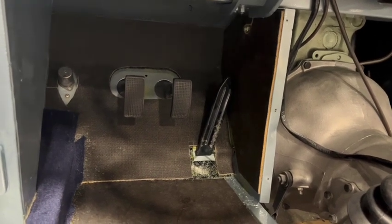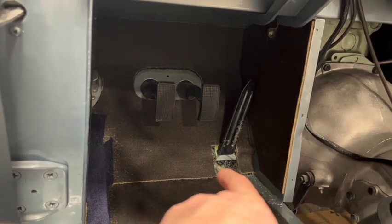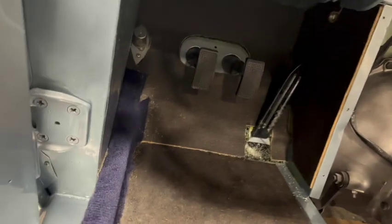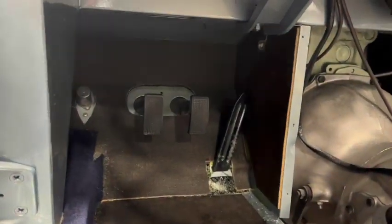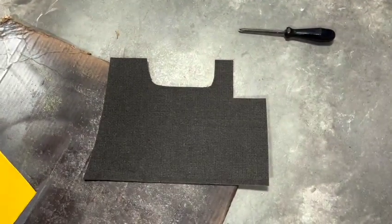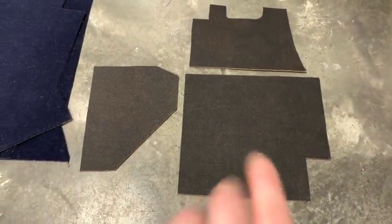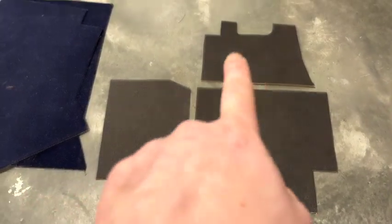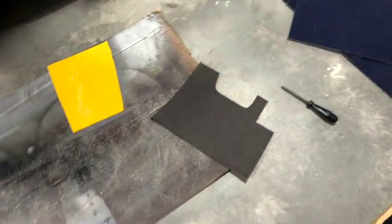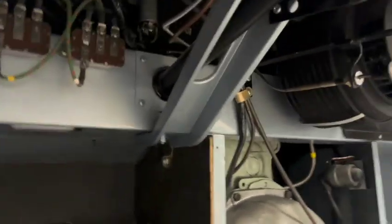There are the two jute panels installed with the sound deadening underneath of them — you can't even tell other than that little spot which will be covered with carpet. The next step, once the jute is installed in the toe board areas, is there's still one more piece to go in at the top — a lot of people forget to add that piece, but most companies don't sell it; however I do. There's one for either side: the straight piece that does the 45-degree angle, the inner side piece, and then the top piece — that little cutout goes around the vents in the top. That's an air box for fresh air to come in; when you open up the fresh air tube it blows down on your feet through those vents.